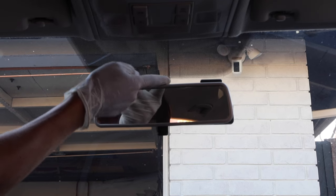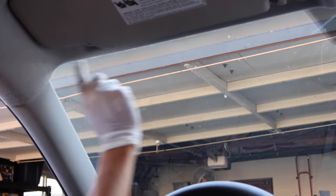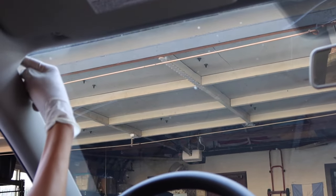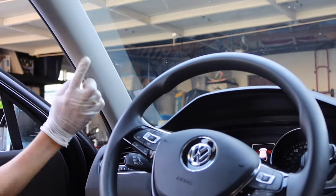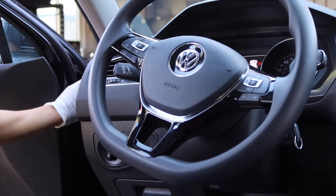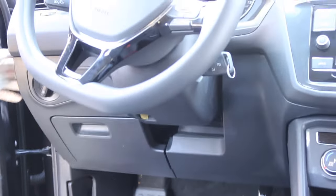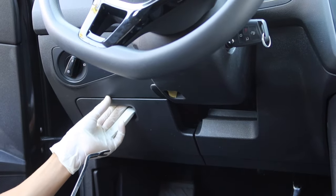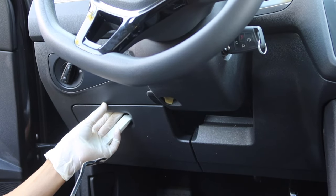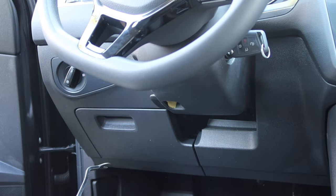He's going to route the cable up from behind the rear view mirror, up into the liner, and from the liner over to the A-pillar. From the A-pillar, down behind the airbag — which we do not recommend doing. You must be a professionally trained technician to do this, as you could accidentally deploy the airbag and cause serious harm as well as damage to your vehicle. Then from behind the airbag we go down to the fuse box, which is behind this compartment.